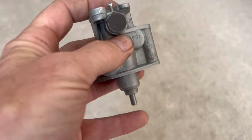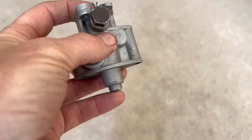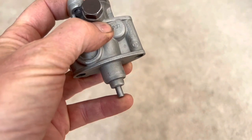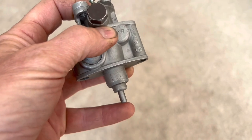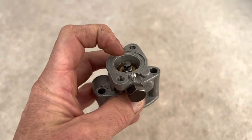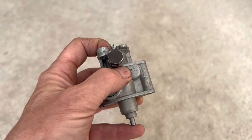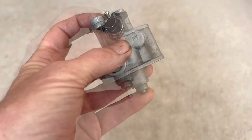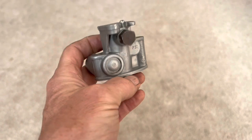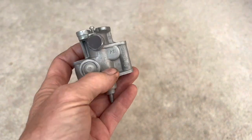The way this works is that this piston at the bottom presses down on a lever in the fuel injection pump. The more it presses down, the more the flow of fuel to the cylinders is restricted. As the thermostat warms up, a lever comes out the bottom of the thermostat, pushes down this piston and pushes that lever out. As the car warms up it requires less fuel — and that is the purpose of this device: to get the car running smoothly as the engine warms up.